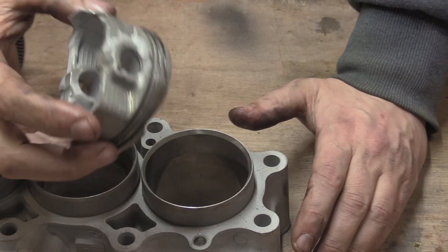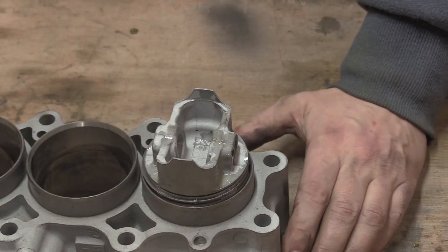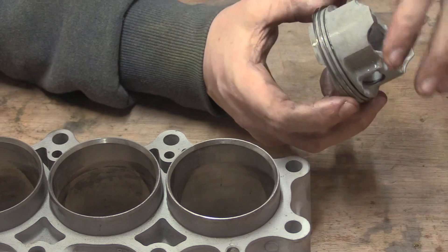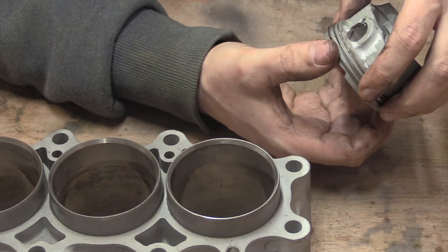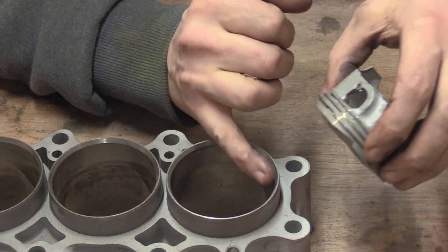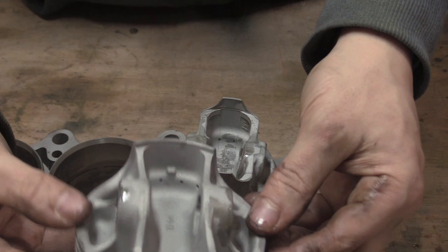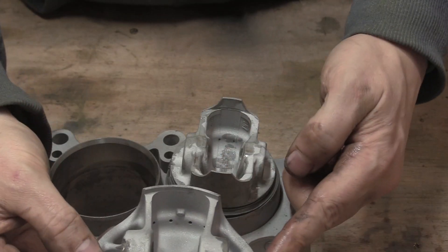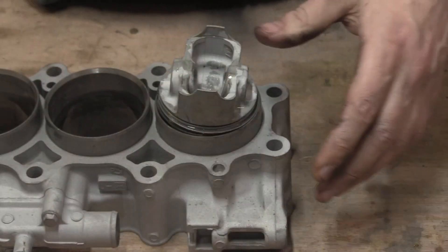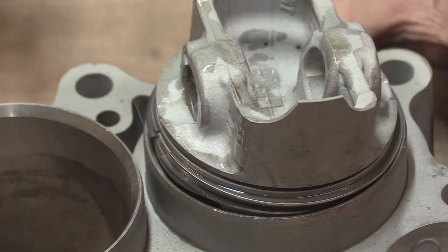The way you do this is you'll have your crankshaft with the cylinders poking out and so forth. It can be a pain, so I've separated this out just to show you the technique. On these spigots there is a chamfer, and all you need to do is coax the ring to sit against that chamfer. You get the closed end — opposite the open end — and back it into the wall. I'm putting the closed end on this side and jamming it in, which pushes the open end of the ring outward so it opens out.